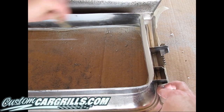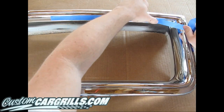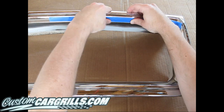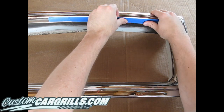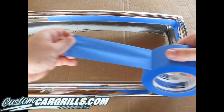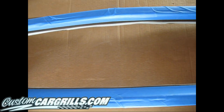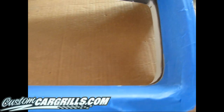Now it's time to go ahead and paint where we just got done sanding. I like to use a low adhesion masking tape — this is just the blue painter's tape you can get store bought. This is a fairly time-consuming process where you're going to need to outline where the painted surface meets the chrome surface. Obviously we don't want to paint the chrome, so you need to make sure you mask this off very well and very accurately. Once I get a good fine outline, I'm going to take some of the wider tape and do the bulk of the chrome much faster than using the small roll of tape. I went ahead and masked everything off — it should be all set. All we need to do now is just paint it.